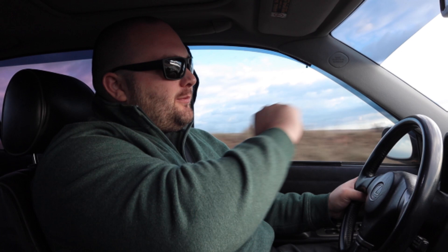I am not in love with the sound. I guess that's what you get when you put a header on an IS300 or a non-turbo 2JZ. I did have some fitment issues later on that I discovered — one runner was resting on the engine mount, and that was adding vibration to the cabin. That's why I think it was hard to get the header on. What I did to correct it: I jammed a pry bar in there and hammered it, smashed the pipe up a little bit to make it clear the engine mount. If you go this route and install this cheap header, check that clearance first, and if it hits, hammer it before you put it on to dent it a little bit, or you can file down the engine mount.